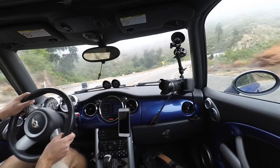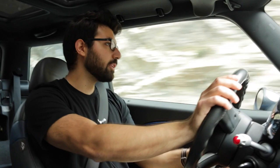I've also swapped out the original brakes for a Wilwood brake kit. That upgraded the rotor size to 11.75 inches and provides a much beefier caliper to handle heat dissipation. I've done multiple 20-minute sessions at our local racetrack Willow Springs and I've never had any brake fade issues. That also comes along with braided steel lines and upgraded racing fluid for the brakes.